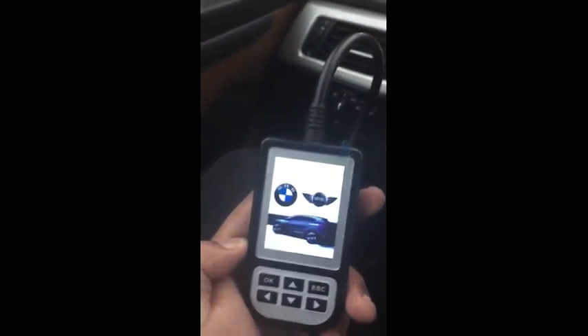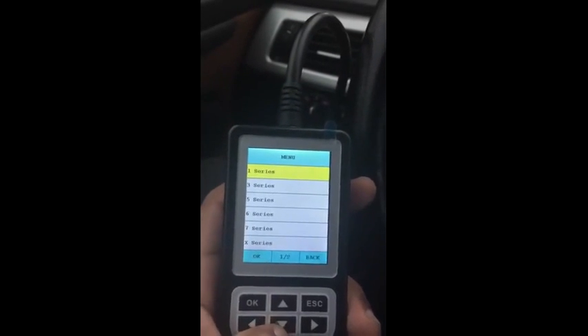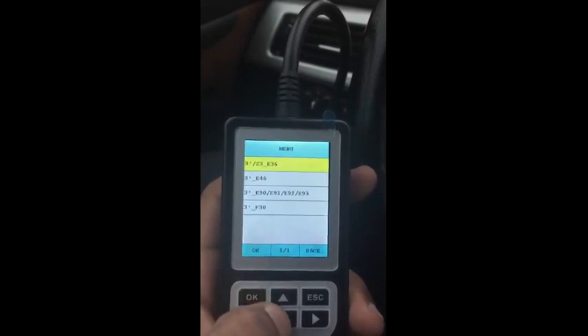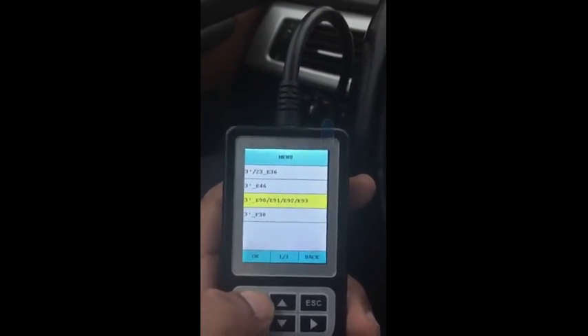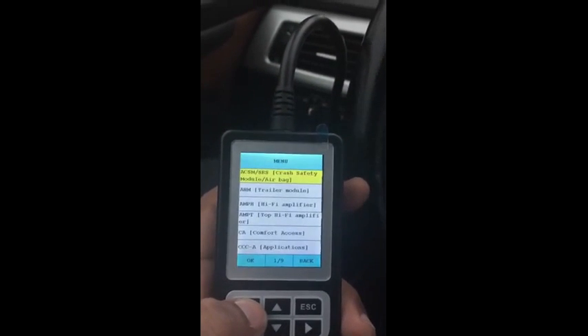How you doing folks? You ever see this light come on your BMW? I have a 2008 328xi and we're gonna get to the bottom of this code here — it's a faulty airbag code. It could be various reasons why this light comes on, so we're gonna get to the root problem. We have a scanner here that's good for BMWs. We hit okay, go to diagnose, select the 3 series chassis, and then go to body.